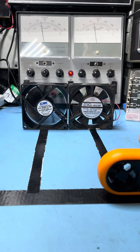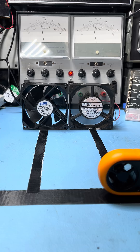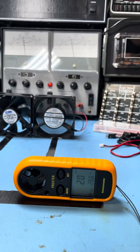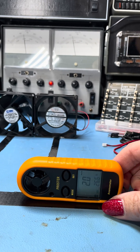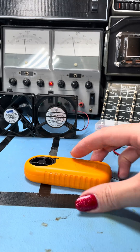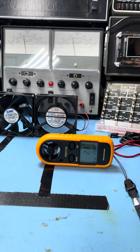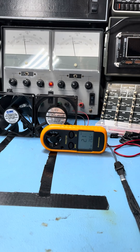Let's switch that off and go with the old fan. We're back to 180 millimeters — way noisier fan. I'm going to have to move the camera over or you won't see the result. We're getting 2 meters per second here at 180 millimeters. Going to 100 millimeters — keep the vanes in the middle — we've got 2.3 meters per second max. Then going to 50 millimeters, we're actually getting less.